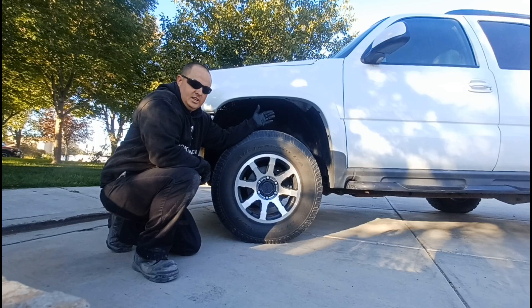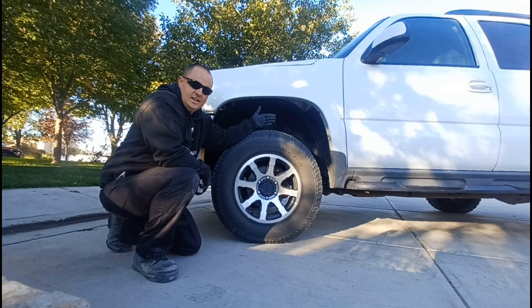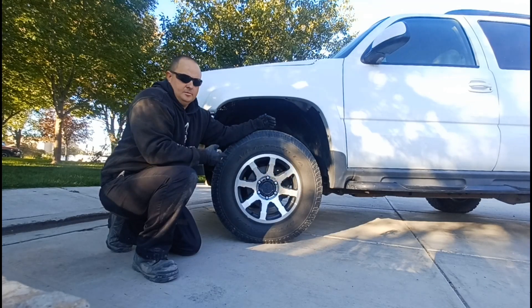That way you can decide what lift you want or need, or you can use it to compare your current vehicle to what you can probably get away with on the Tahoe overlanding axle swap. What I can tell you is that 24 inches is about the lowest that I would set a Tahoe overlanding axle swap, because that would still give you adequate upward travel — about three and a half inches at the bump stop to clear for the axle to go upward.